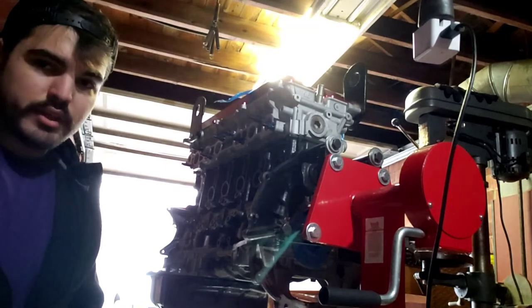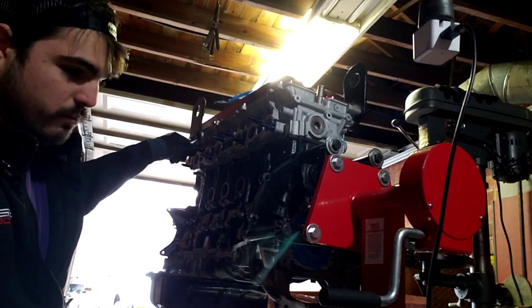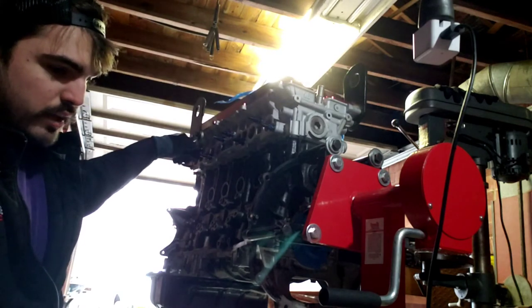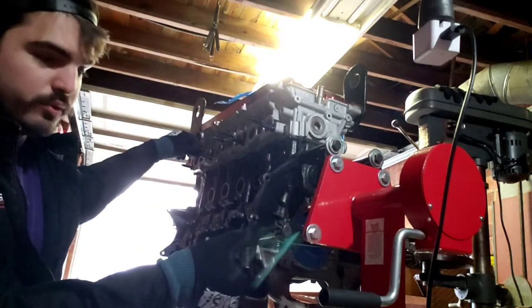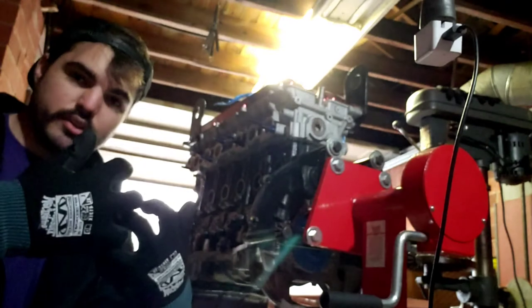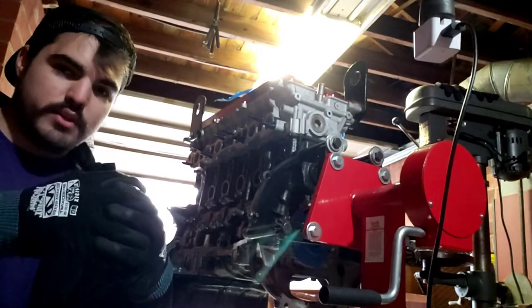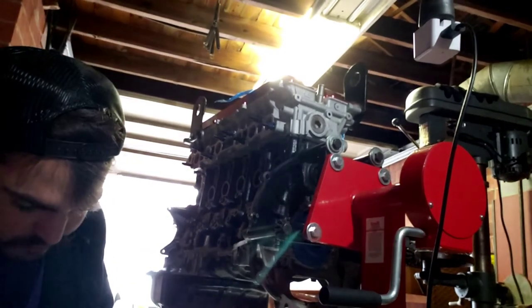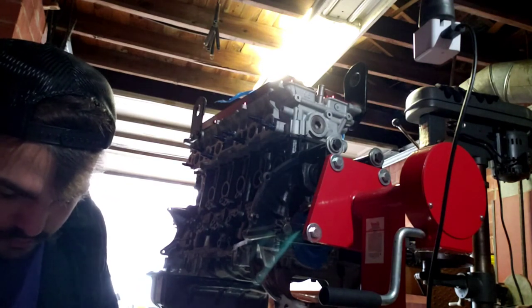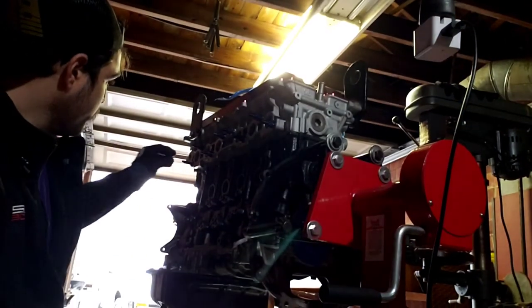so that I'll be able to downshift, because they do make tapered ones. If you have any idea what a dog box is, it's like these five lugs that kind of look like rectangles around a ring, and when they engage, it's a really solid engagement. It's not like a synchro where you gotta get everything going the same speed with a little brass synchronizer. These are like hardened forged steel face plates on there. Oh, and the face plates are removable. That's a big deal. That's really nice.